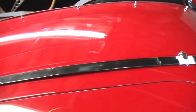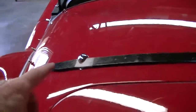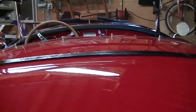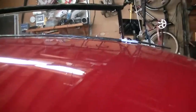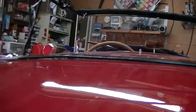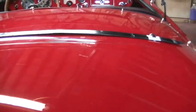Here's the rear metal piece that goes inside the slot in the convertible top. Mine was fitting with great difficulty into the chrome retainers — probably a little too much chrome, or I painted it a little too high — so I ground it down just a little bit to make it thinner where it goes in. I also was not conforming at all to the shape of the body, so I bent it to kind of conform, leaving a pretty even eighth-of-an-inch gap between where that rail sits and the body, assuming the convertible material underneath is going to take up some space.